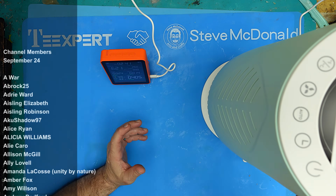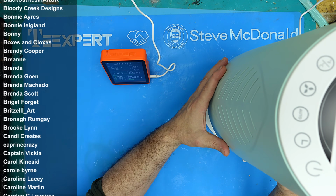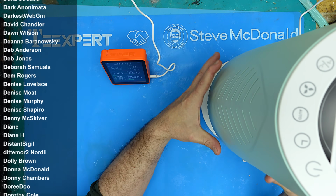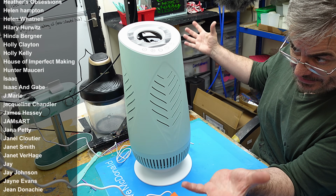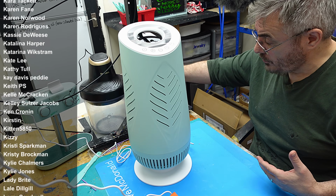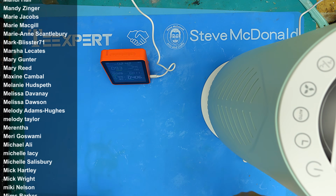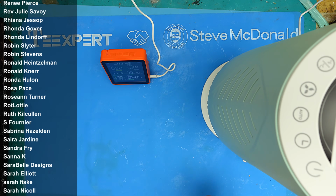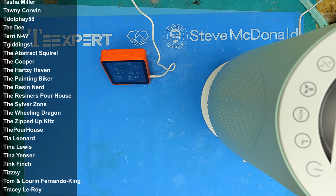Normally the core component of a purifier would be a carbon-based filter, which stores everything up in it. But once that gets full, it has the chance to release that out into the atmosphere again. That is why you should change your filters as regularly as possible. This is designed for a room of about 161 square feet, which is 15 square meters, and actually my room in here is below that, and this is still quite a large room.